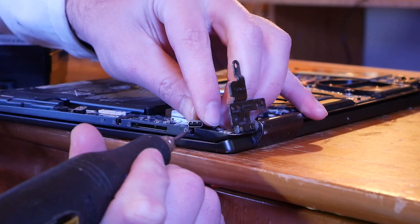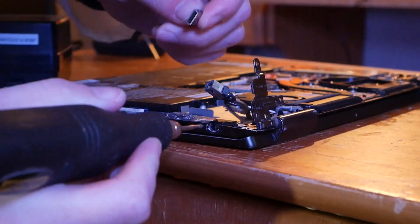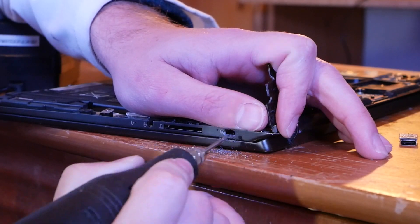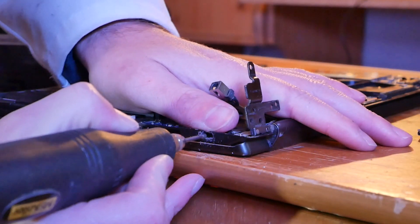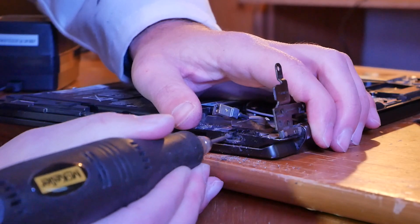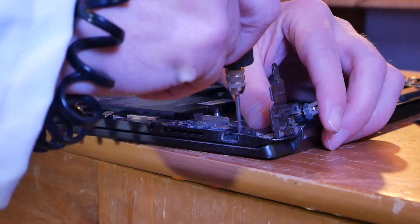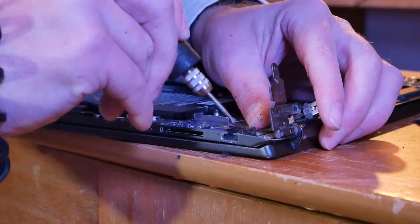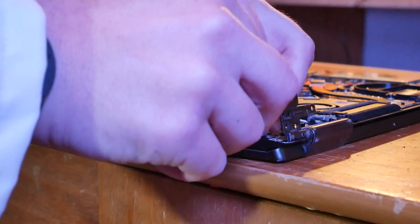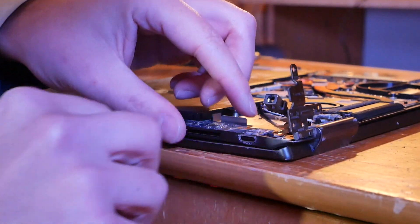I didn't even make a template for the USB port — I just held it near the socket and proceeded dremeling out the metal and plastic bits. I was very careful because on one side I had a light and I really wanted to retain that charging indicator. In hindsight I should have used a plastic bag to protect the motherboard PCBs from metal chippings, as they could cause a short. So I took extra time to clean up the mess with a dremel and used a painter's brush to brush off all the chippings. If you're watching this before starting, I'd strongly recommend you do that.